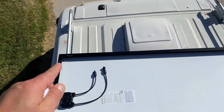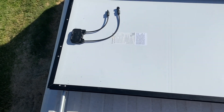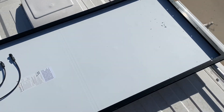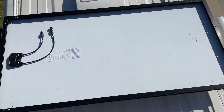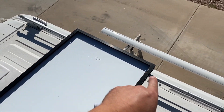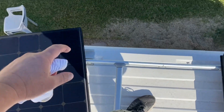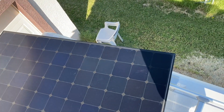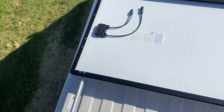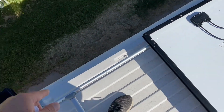These used panels have an extra hole from where they used to have a mount set up on opposing corners, and it just works out without straddling the holes I need — totally fine, the u-bolts will work out perfect. I'm going to drill them all, flip the panel over, attach this side, lift this side, run the wiring down the driver's side down the rear column and into my power area inside the van under the bed, then bolt down this side.